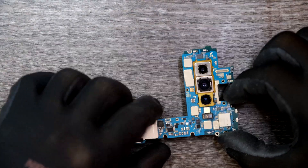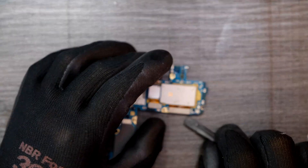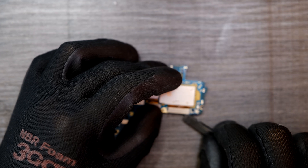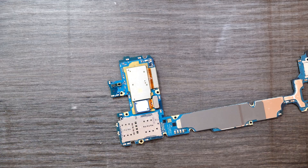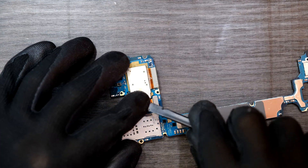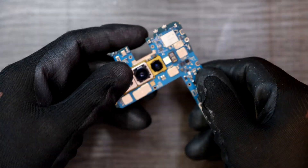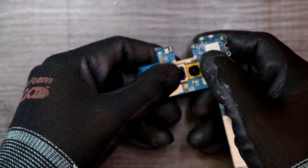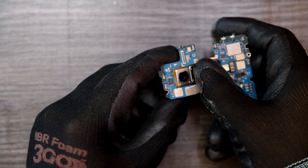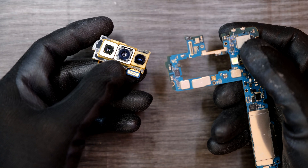The connector is connected in the back — connector is right there for the rear camera. Remove. Oh, I just forgot one more connector right there, we need to remove this one as well. And then we can just push this camera unit out, just like that.